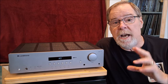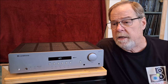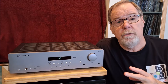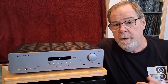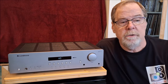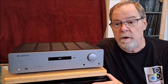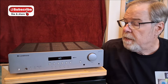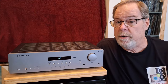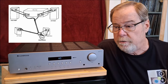It has a set-level record out if you want to go to a tape deck. It also has a dedicated subwoofer output crossed over at 200 hertz. There's no bass management built in, but you can use the bass management in your subwoofer, or some other device we'll talk about later. It works extraordinarily well — that's how I used it for the longest time on my big Def Tech sub. The unit's wonderful, sounds great, has a lot of flexibility, and it can run two pairs of speakers. I've run a Hafler surround wiring configuration on it for years.